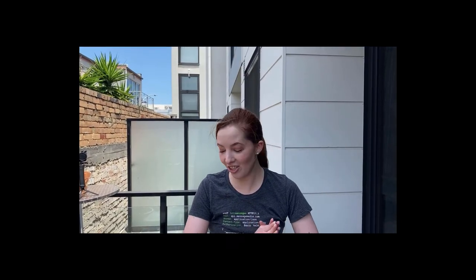The other thing to note is we've filled these up at different PSI ratings. The PSI you need in each tire is based on the weight the scooter is going to carry — these are for two different-weight people, so we've filled them up slightly differently. There's a table provided by Xiaomi with the PSI ratings they've been tested for, so I'll link that.